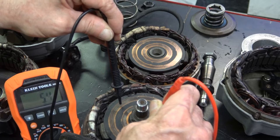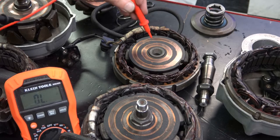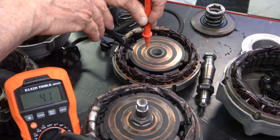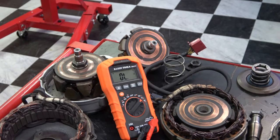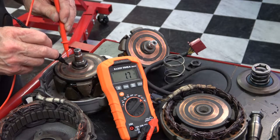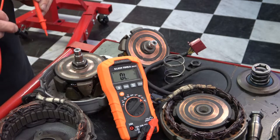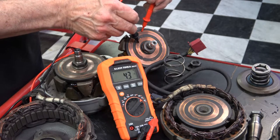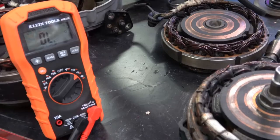We're starting out by checking the rotor. You get a multimeter, set it on the ohm setting, touch the two contacts, and you want it to read somewhere between four and five and a half — that shows the rotor is good. This particular one I'm checking is only putting out 1.4 to 1.5, so that rotor is no good. But the first two I checked are good — one reads 4.0 to 4.2, the other was over five.